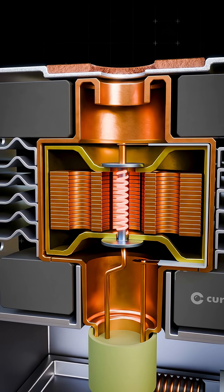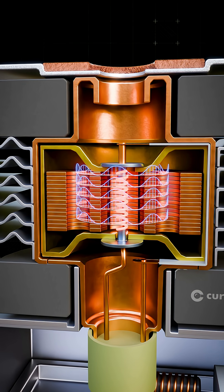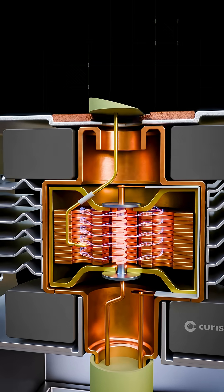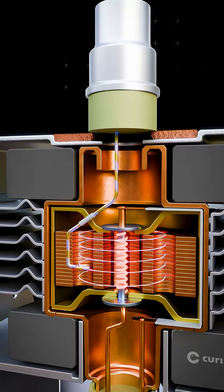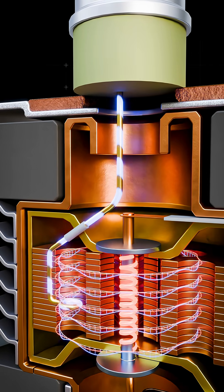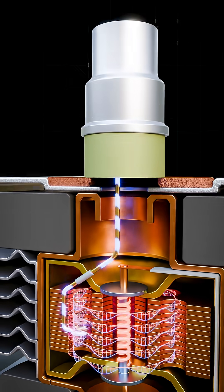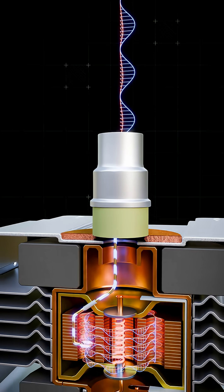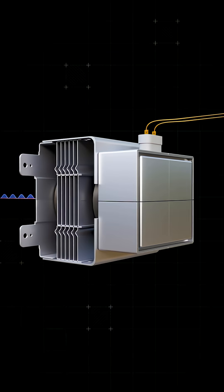The resonator cavities are all coupled, so the electromagnetic energy from the entire system can be extracted by a metal antenna loop, connected to only one of these cavities. This antenna picks up the electromagnetic microwaves and sends them through a waveguide, which is a hollow metal tunnel that directs the microwaves into the cooking chamber.